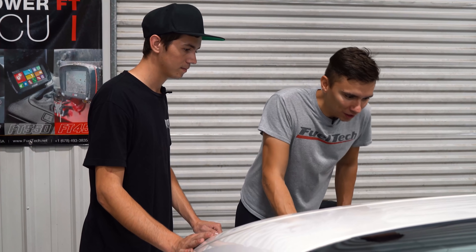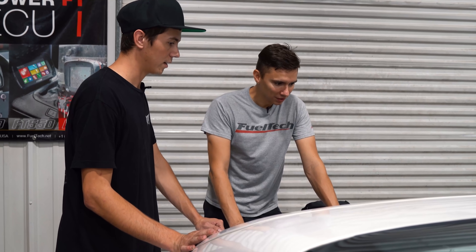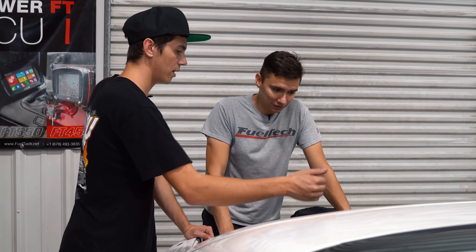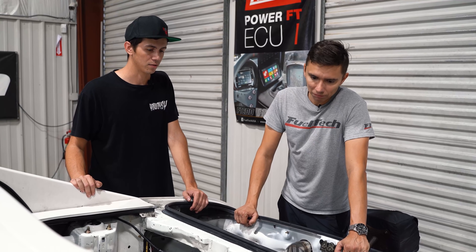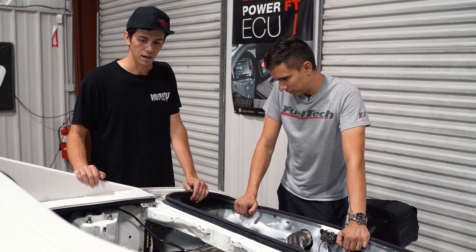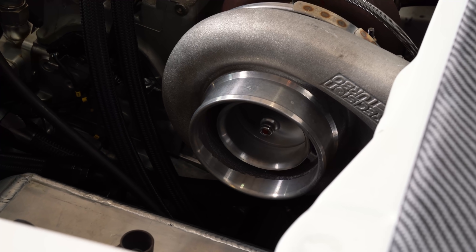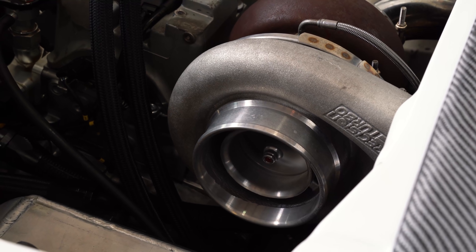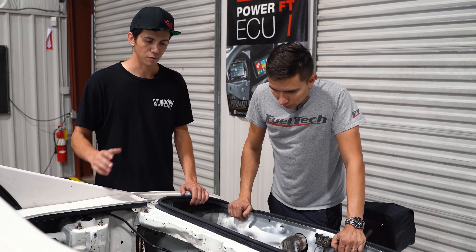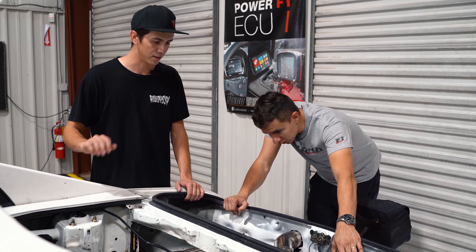The wiring on the motor seems really clean and easy to reach for maintenance. We did it all in-house because it used to be twin turbos — twin 3582Rs, knockoff Chinese turbos. We went really fast with those, and then we decided it was time to go more legit. So we went to a big single we can rely on at those high boost levels. And we added all of our necessary sensors — before, the only sensor this car had was an air-fuel gauge, and that was it. Now we have everything working properly.